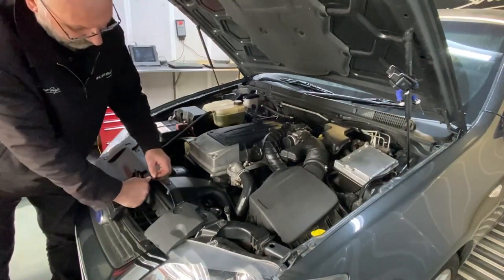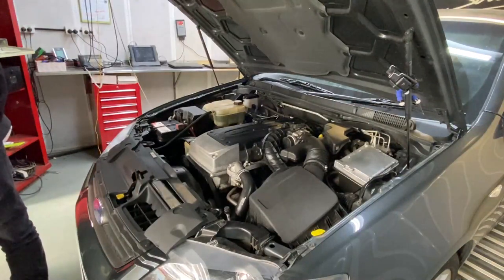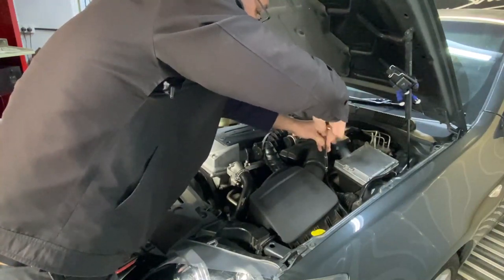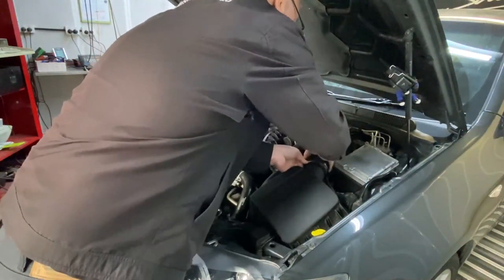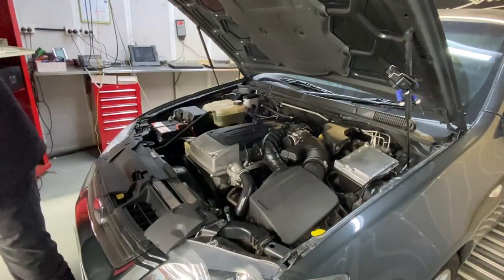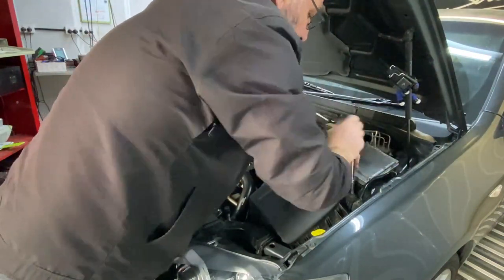Plastic clip. Snout. Okay, so we'll remove the standard ducting from the airbox lid, just back it off, don't have to remove the clamp all the way. And we can just pull that back a little bit. Now that's pretty loose. So you can leave that loose, and once we undo the main bolts, that'll come out. Now, there's only two bolts holding the main housing here.